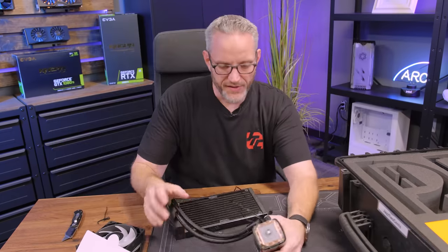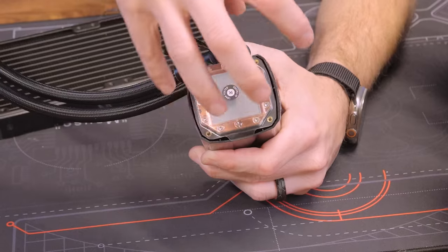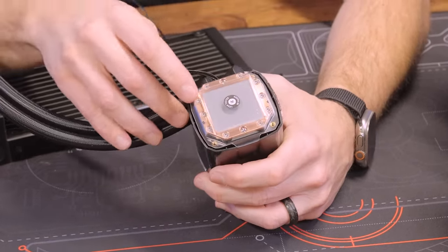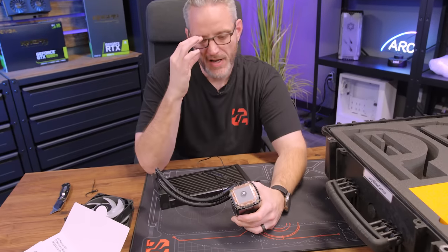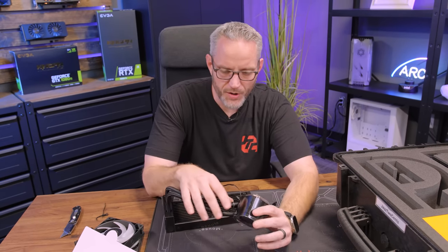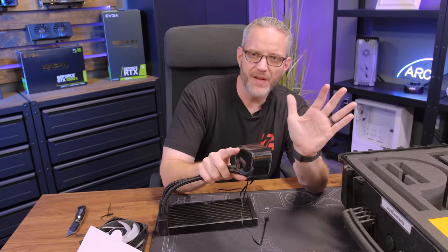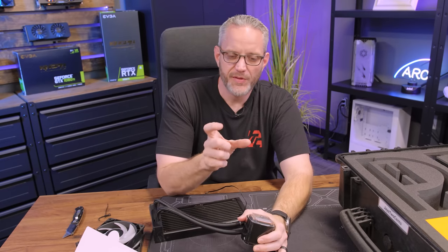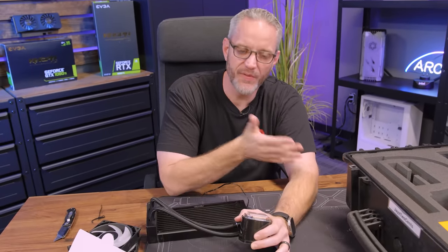The bracket actually attaches on this end — you can see there are screws on all four corners, so you'll mount the bracket directly to the bottom. You have to take the plastic off, so be careful not to mess up your application of thermal paste, although they do give you more — there's a tube in there. A lot of companies that make AIOs will pre-apply the thermal paste, but if they don't provide a tube of thermal paste — which costs them maybe a dollar in bulk — and it gets bumped or scratched, you'd have no way to reapply it. So having some included with the kit is a nice thing to have.